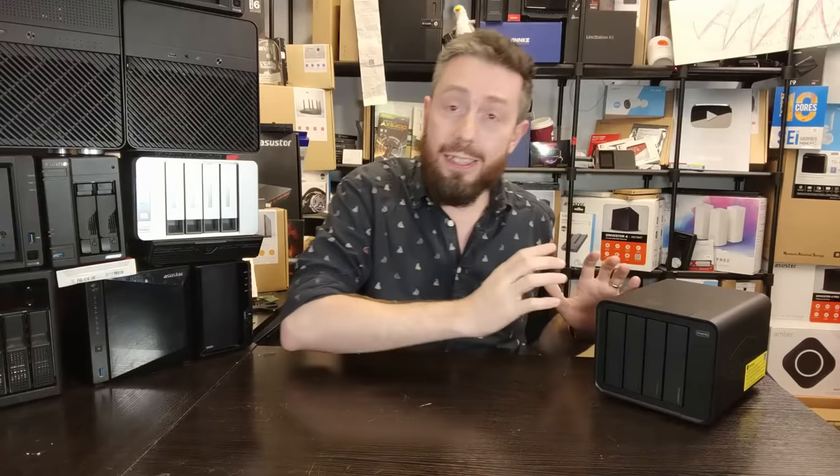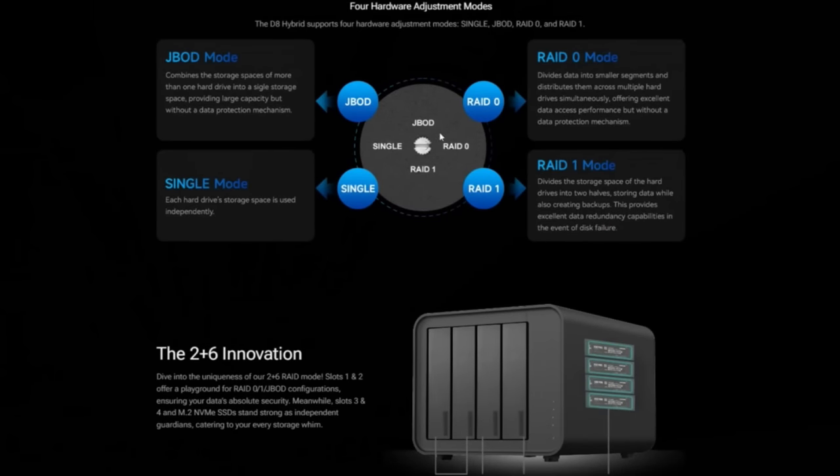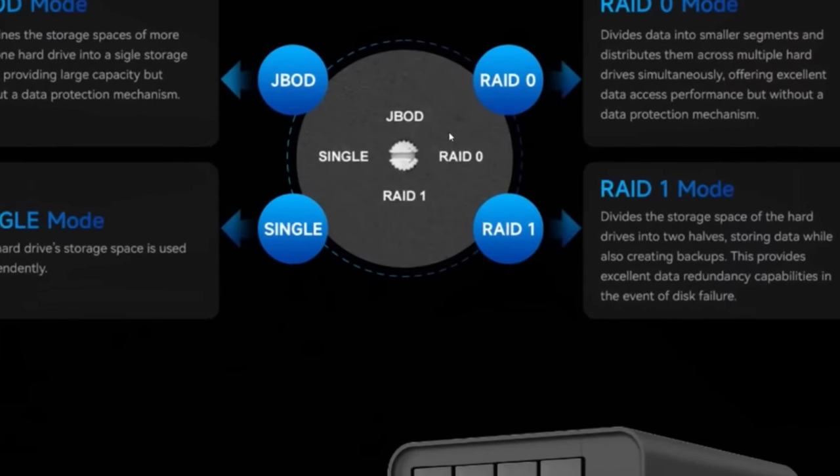The system technically has RAID on board, but it doesn't have RAID 5, which really bummed me out. It arrives with the first two bays in the storage drive area having RAID 0 or RAID 1 — traditional mirror or combined — and all the other bays providing single non-RAID storage that can be managed by a storage controller on your local system. It's better than nothing, at least you've got it, but at $199 to $299 depending on how you get hold of it, it's not terrible.